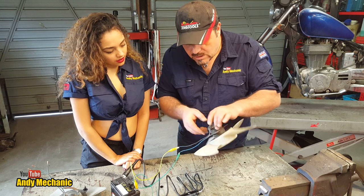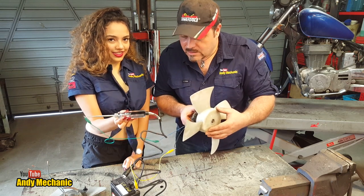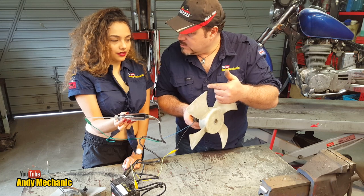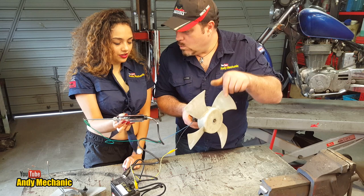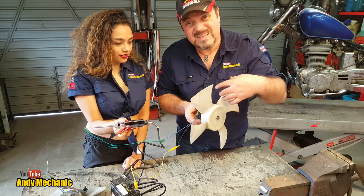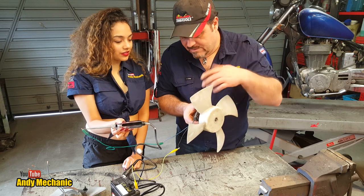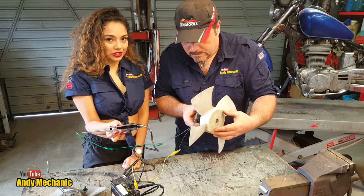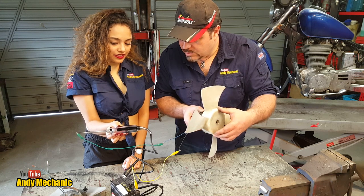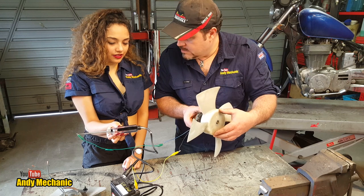As Eric was describing in his video, all you do is turn this motor very slowly. As we turn it, the brushes inside will make contact with different commutator points, and the circuit will switch to a different winding on the armature. So if at any point we get an open circuit, that bulb will go out — highlighting a dead winding or a damaged or worn-out commutator point within the motor. Motors are not really repairable most of the time, so if that bulb goes out at any time, you know you need a new motor. Watch the bulb and see if at any time it flickers or goes out completely. And you've got to do the full 360, otherwise you're going to miss sections.